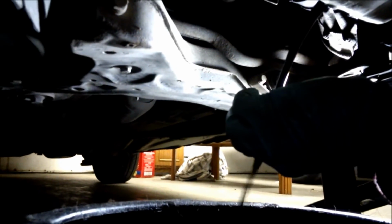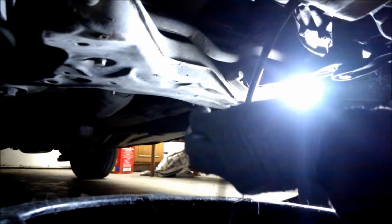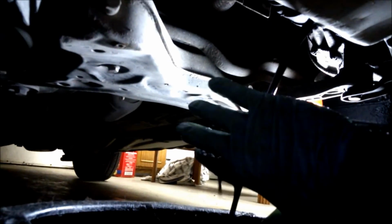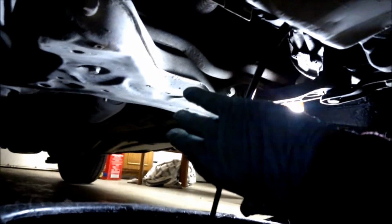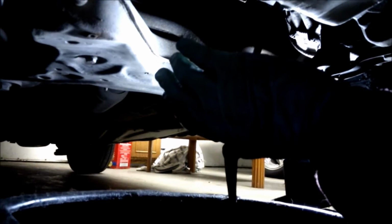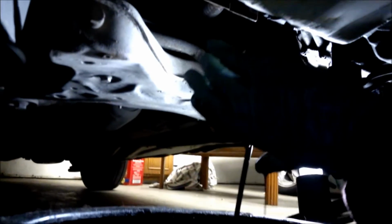So looking at the oil, I'm looking for anything that could be, it's black. Diesel oil is really black, that's normal. But of course, if you saw gray material or a grayish color, that would not be good. Gray material or gray flakes or anything like that would mean you're looking at something as worn. So this oil, from what I can tell, looks okay.